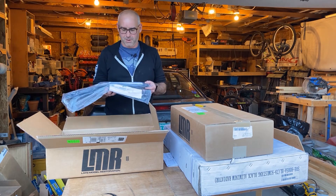That means this box must be my fan mounting kit, which is pretty exciting. Let's take a peek. One of the reasons I ordered this fan mounting kit was the way I have my fan mounted is not great. I actually have the top of the fan mounted to the upper radiator mount brackets — I'm using the four-cylinder one, so they look a little different. There's some room on them to mount a fan, but the bottom of the fan is literally mounted to the rad support, so it's a little bit farther away from the radiator than it should be. I'm just using little aluminum strips that I cut out of a sheet of aluminum. It doesn't look great. So this kit is going to allow me to have a much more secure mounting location as well as just look a little bit cleaner.